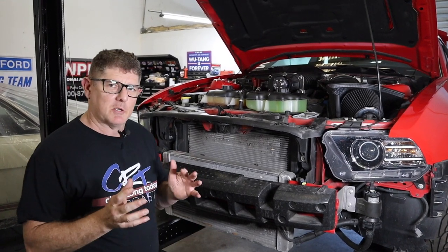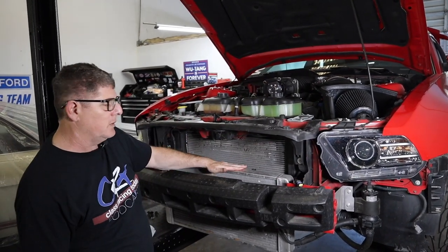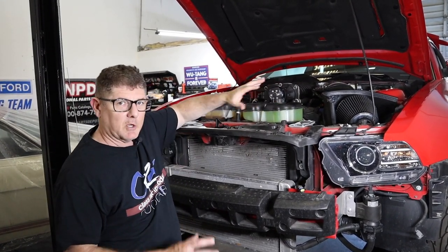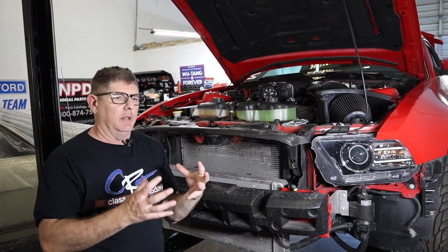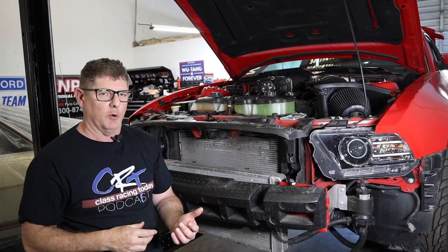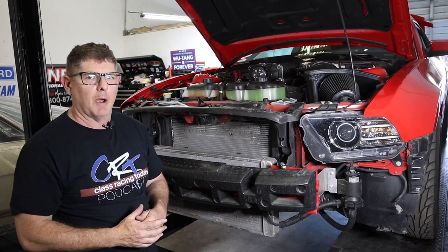The way the car is set up now is basically a closed system. You've got a reservoir here that holds the coolant, you've got a heat exchanger — water flows through the pump, goes through the heat exchanger into the intercooler, and then back to the reservoir. What we're going to be doing is deleting the reservoir because we have a big tank for ice water now, and we're also deleting this pump because we'll have a big pump mounted in the back of the car. With this reservoir and this factory-style cap, you could put ice in there if you want, but it's only going to chill down a small amount of coolant and it's not really designed to have the lid off and ice being put into it. The setup we're going to have now is going to allow us to ice the thing down so the water circulating through this system is going to be chilled down, and we'll pick up the performance of the car by running ice through the intercooler.